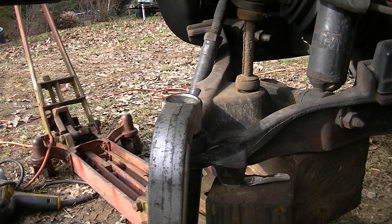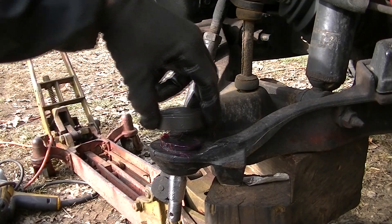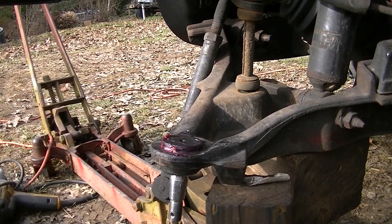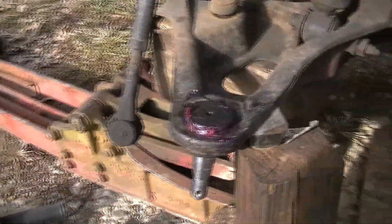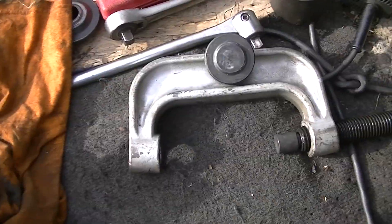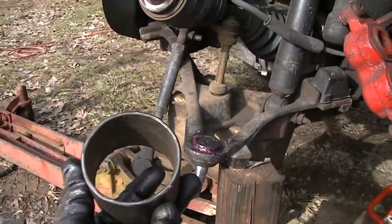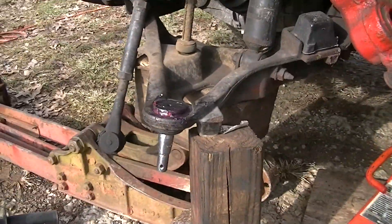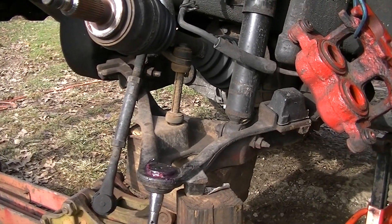It's in. When you're pressing it in, make sure this cup on top stays centered because it's easy for it to get off-center and you'll just be squeezing it instead of pressing it — and it's in. That was a job. Unless they make a special ball joint remover for this Expedition, it's a really hard way to do it, but this tool did work. You really have to use a hammer sometimes, and the big ring just won't stay centered on the bottom of the knuckle. I'll check and see, and you might want to too.